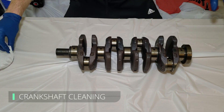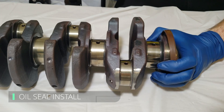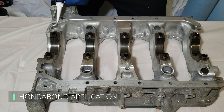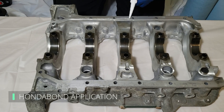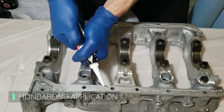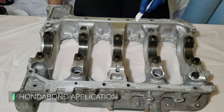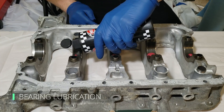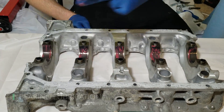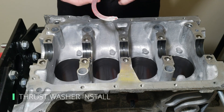While the crankshaft was out, I used a little bit of assembly lube to install the oil main seal — you'll see in a bit why this may not be the best idea. With the girdle cleaned, lay a small bead of Honda Bond on the engine block mating surface and spread it with your finger for an even coat. Then take assembly lube and spread it on your bearings, being fairly liberal since too little can be a problem. After cleaning your thrust bearings, put assembly lube on the flat side and install them — there's a designated cutout and the lubrication will help hold them in place.